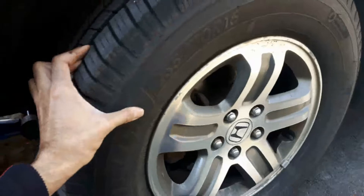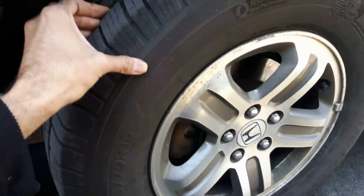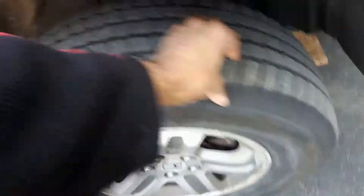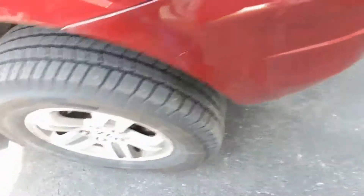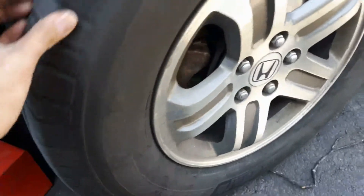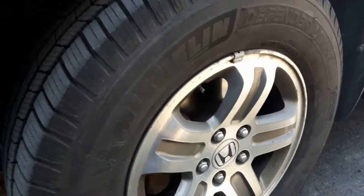You should be able to move the wheel easily. This one is going but not going as well — it's very tight actually. The other side is a lot easier. So this is the caliper that's failing; we'll take this wheel off and replace the caliper.